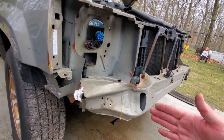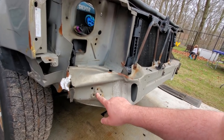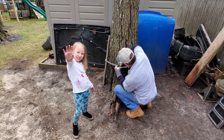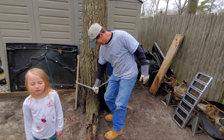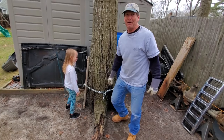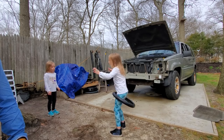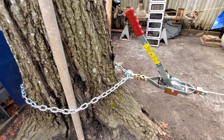Since the impact looks like it was straight on right at the bumper, I'm going to hook up something to the fog light mount, connect that to the come-along, put it directly against this tree, and pull it out. We got our helpers — project Dad H over here. Hey, remember why we bought the come-along to begin with? To pull a bumper out, I think — your Mustang.